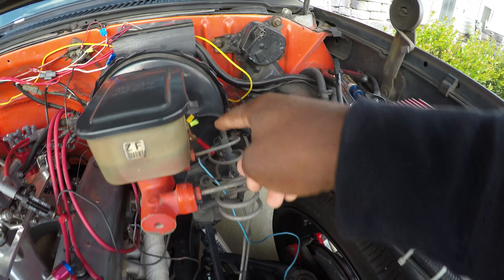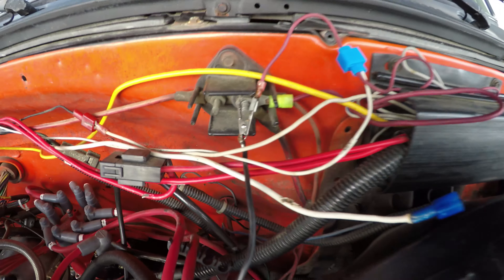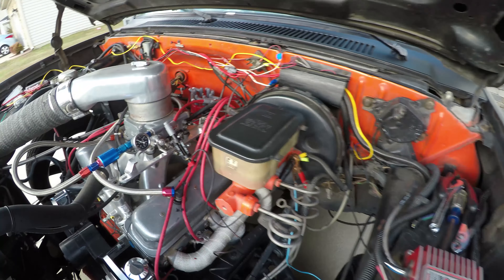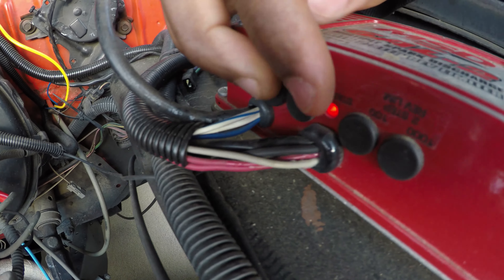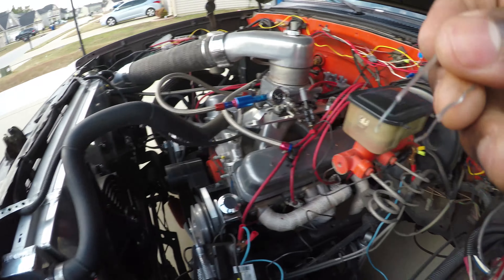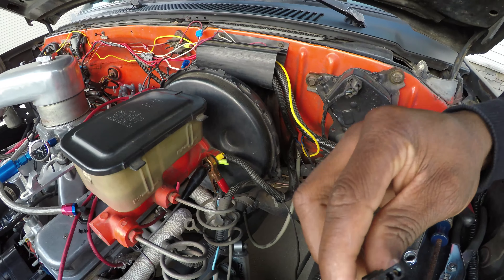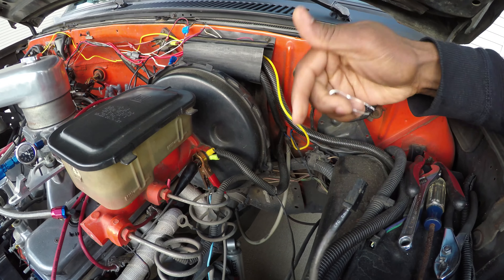So I got my negative going to my ground for the 6AL, and I got my positive going to the switch as well as to the constant 12 volts. And once you got power going to the box, you usually might get your status light on right there unless that light is for some reason blown. Then you just get a little piece of wire — you can even use the little wire wrapper that ties your bread up. And all you got to do, whether you're using your tach wire for the pickup or your magnetic coil wire, either one of them will trigger the box.